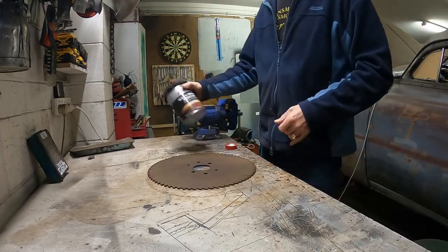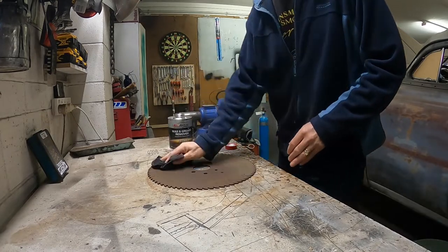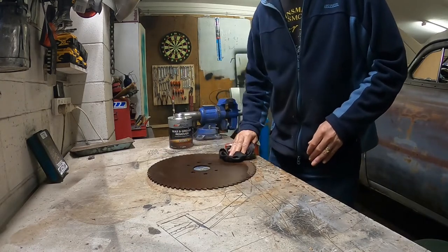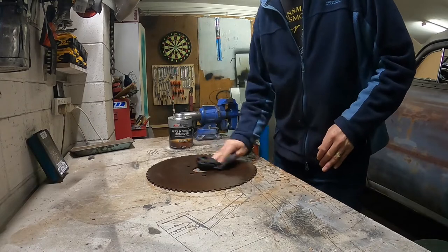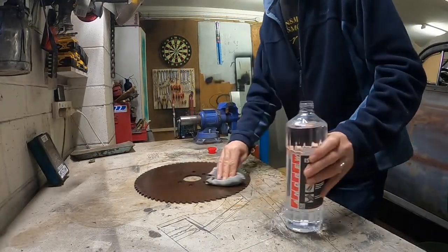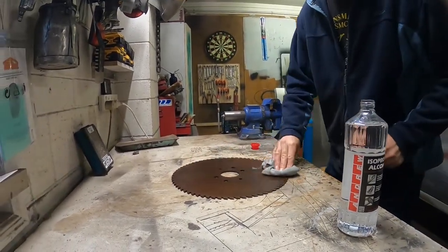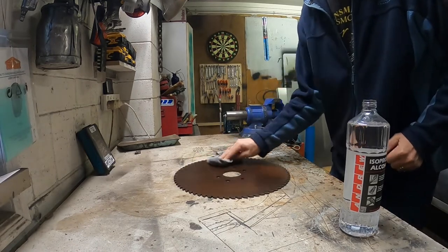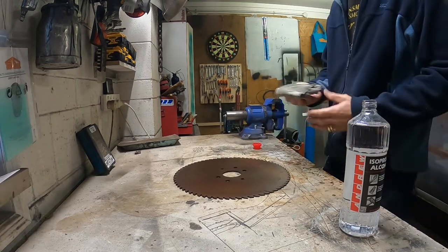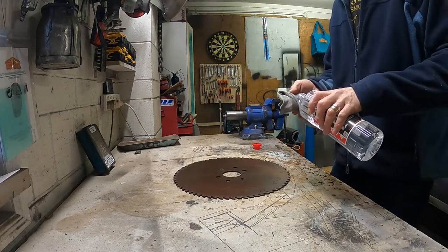Just give them a quick wipe down with some wax and grease remover. Not that there's really any wax or grease on here, it just will help pick up any of the loose rusted dust that I leave behind. As with all painting systems, preparation is key. Being that I'm painting over raw rust, that slightly distressed, unfinished look is what we're looking for ultimately.